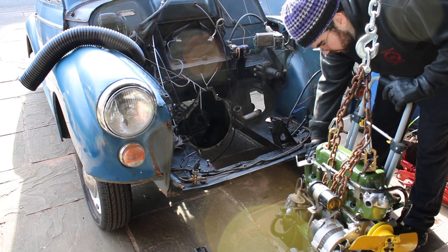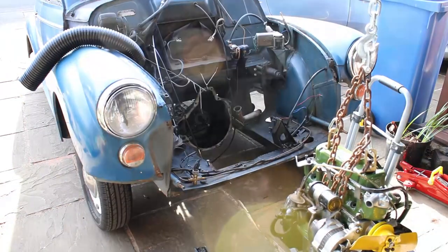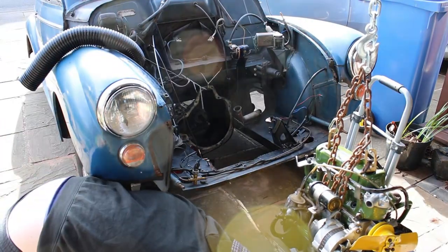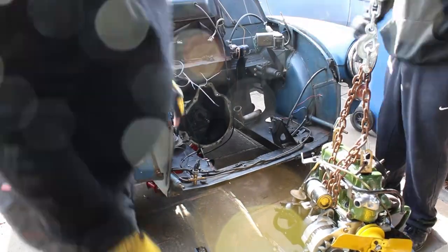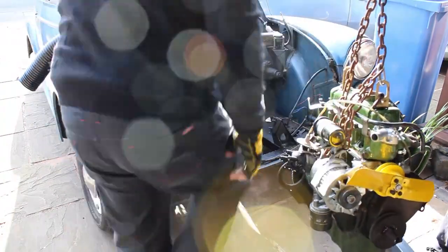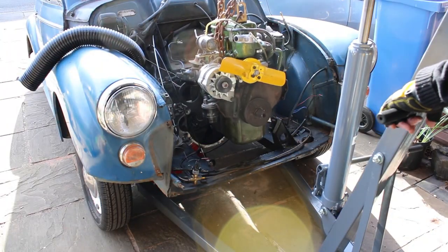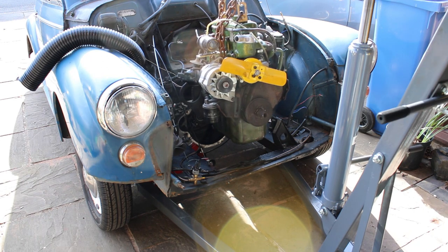Moving on to putting the engine actually in. I was missing a quite important tool when doing this. The Morris Minor engine cannot go in straight — it has to actually be angled to go in, and I don't have the angling tool. There's a tool that would attach to the top two bolts of the engine and allow you to tilt it on the engine crane. I didn't have that, so this involved an awful lot of faffing about. I'd already installed the gearbox — it was just the engine that needed to go in. One of the things that made me nervous is that the brake line actually runs right at the front at the cross beam, and if I crush that, it would be fun to fix.